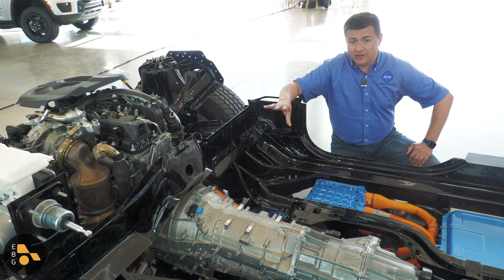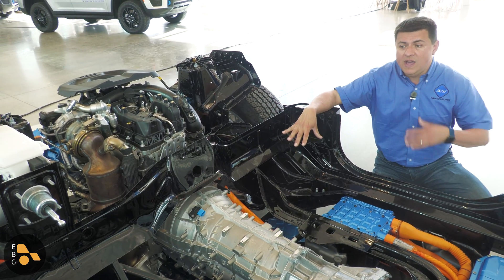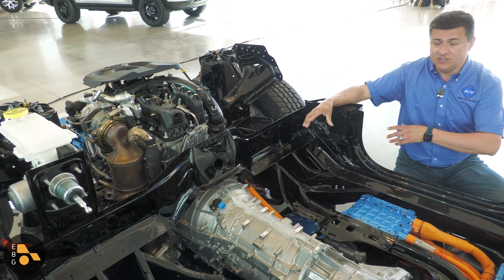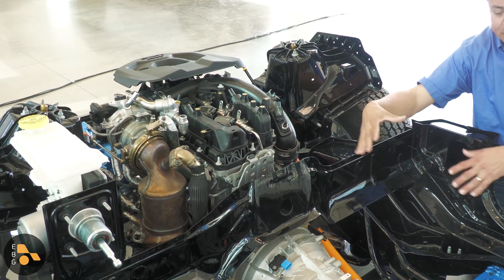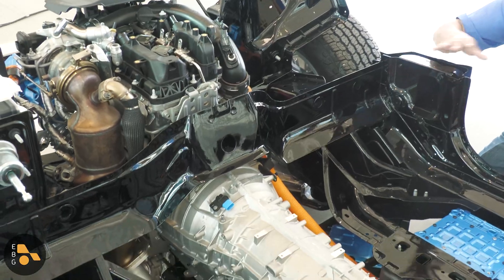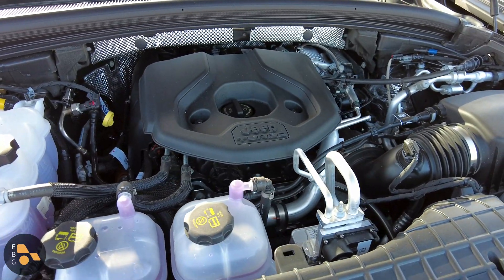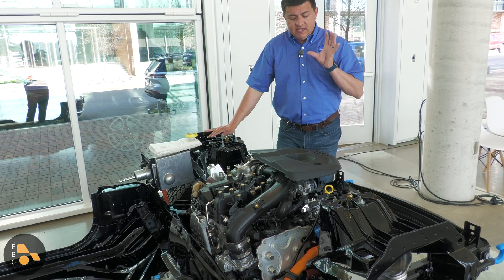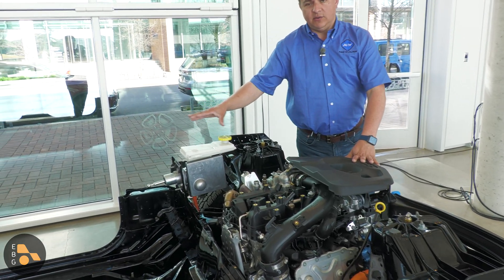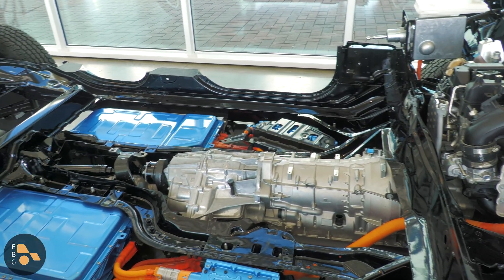The one major change between this and a regular Grand Cherokee is that it no longer has a torque converter. Right back here, we have the electric motor unit in the bell housing where the torque converter would normally go. We then have a clutch pack unit between that and the engine. So how this works is the 44 horsepower motor up front will start the engine, then it will close the clutch pack, and then the engine can drive the vehicle forward. In order to make the transitions happen more smoothly, that's why that motor unit is a little bit more powerful than you might suspect. Once the battery pack has been exhausted, this will revert to a normal hybrid mode of operation, combining sources for the best efficiency. This will always maintain a specific charge in the battery, so if you don't have the opportunity to plug it in but still want all the power from this combined system, it is going to be available for you for a while.